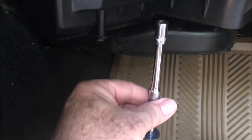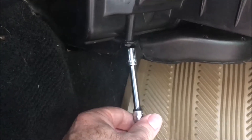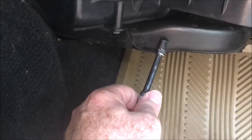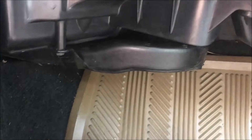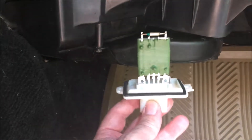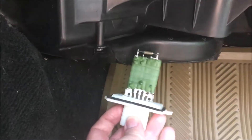To help get in there a little bit, I took this one off — same size, 5/16 — and dropped the air plenum down a little bit, just kind of cocked it down so I could get the wrench up in there. That's about it. It's pretty easy. Now I have all the speeds on my fan. Just two bolts, 5/16, drops it down.